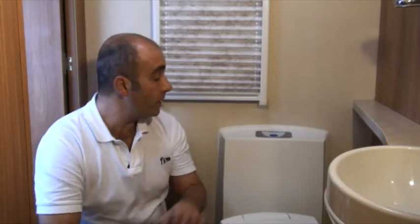The second type of cassette toilet draws its water straight from the water supply — either from the fresh water tank onboard or the barrel outside. You'll find that those ones are electronic. When it comes to draining this particular toilet, very simply, just like any other outlet, you press and hold this button. You will hear a distinct difference between the water coming out and then the air following behind. When you hear the air, you know there's no more water in the mechanism and it is then frost protected.